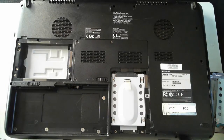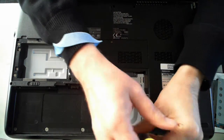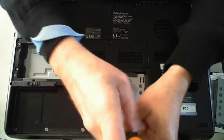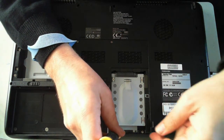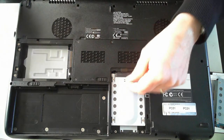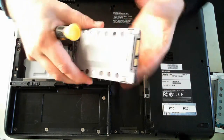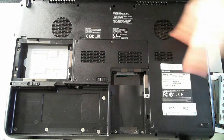The other drive bay also has two screws — just remove them. It's held in by another two Phillips head screws. Put them to one side and again there's a little plastic tab, just push it downwards and out. This one is also held in by four screws, so you can take them out to get the actual hard drive or in this case an SSD out.